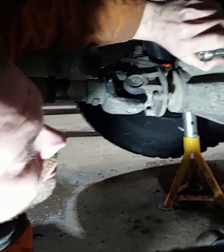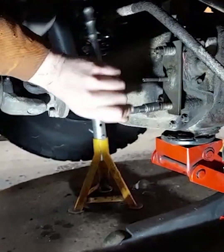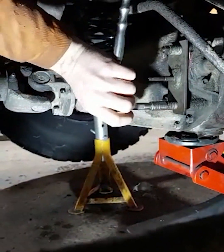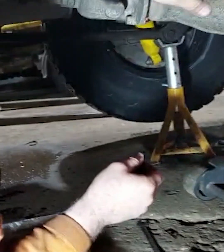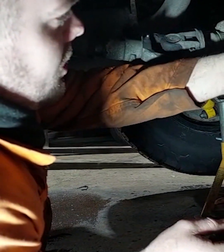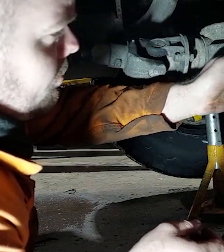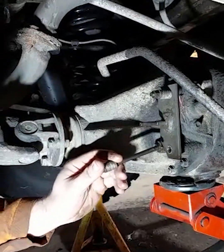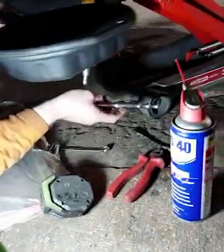There's a lot of washers on here and that's just to allow the long bolts. It's only temporary until you get your diff lock actuator — because they're not cheap. This one normally comes with oil out and John hasn't got us a drip tray, so we're going to lose oil. Let's get a drip tray.